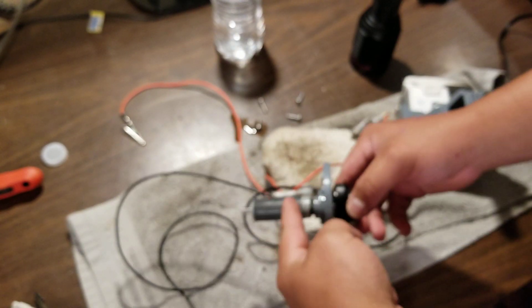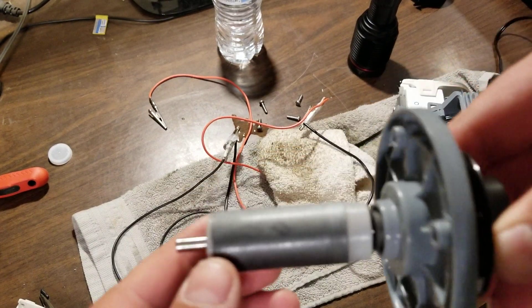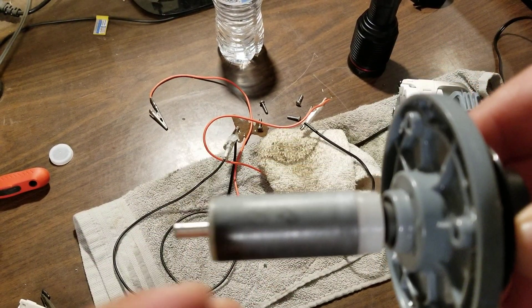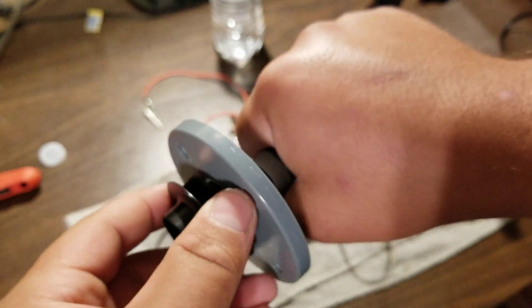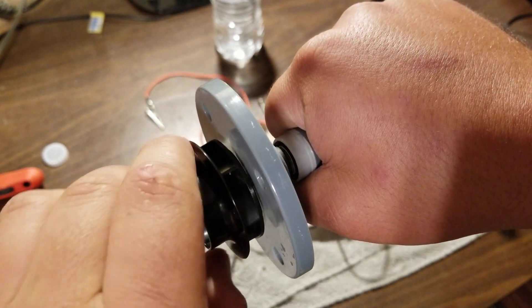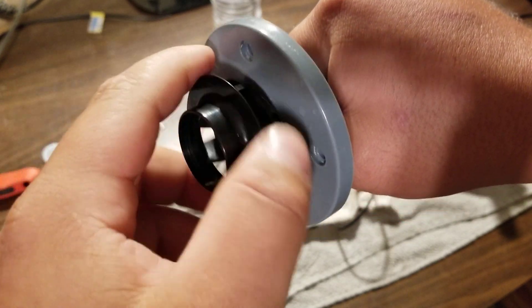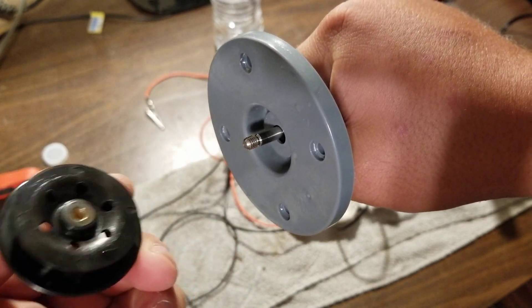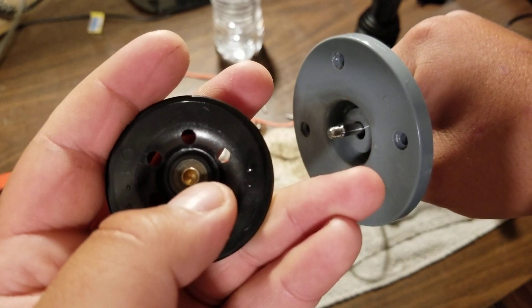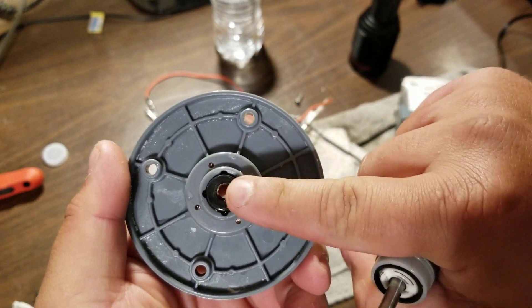What happened is — as you can see, it's magnetic. You've got your rotor here. To remove the impeller, you hold the rotor and turn the impeller counter-clockwise. It may be a little harder when you first do it from the factory, but I've already messed with this, so it comes off like that. Here's your impeller, and then your little insert where they've got the little nut that screws on. And that slides off. And this is the bearing that failed.